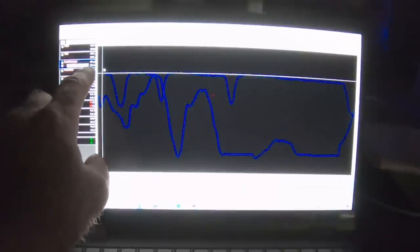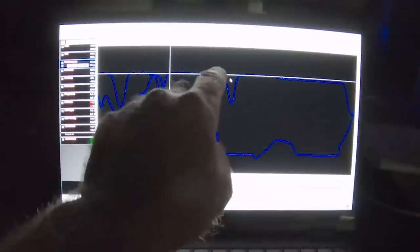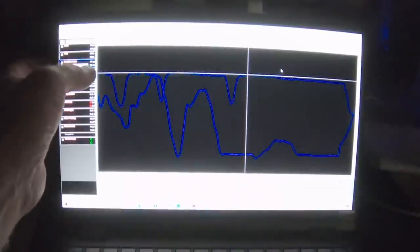Leaves the starting line, gear change, we are good. Fuel pressure, rock solid throughout the run. Dips with the gear change because they're not making boost when I'm granny shifting it, but is right back up where it needs to be, 78 PSI throughout the entire run. Had I gone after drag week and made another hit after we rebuilt the motor with the same fuel pumps, I'd have melted the motor down again. That right there, friends, is the value of a data logger. That's something you don't easily figure out from the seat of your pants until it's too late.